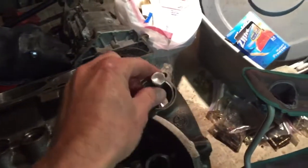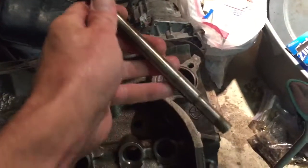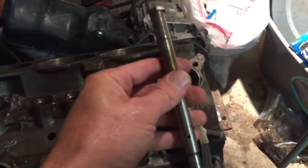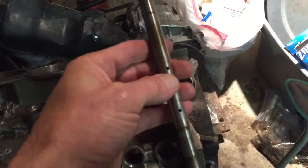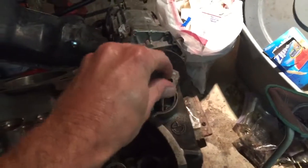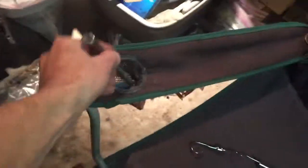So just think about, if you use a motor like this, recover that old camshaft position sensor. It's not easy to get the gear off the end. There's a cam gear that rides here, but it takes a drift pin, and you can get these two roll pins out, and then beat the stuffings out of it, and it'll ultimately come out of there, which is what I did. At that point, I wasn't too worried about hurting it. Wasn't going to reuse it otherwise. So anyway, that's ready to go.